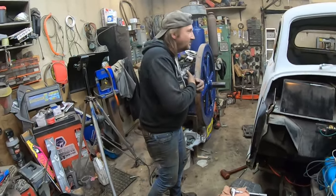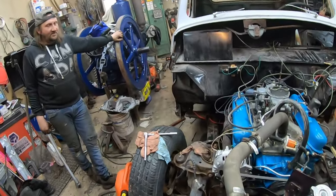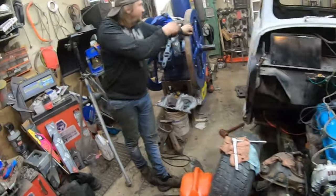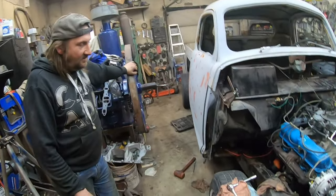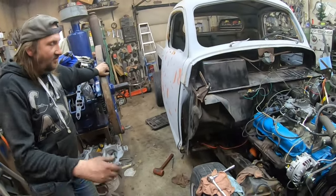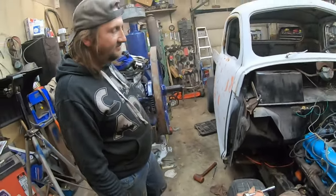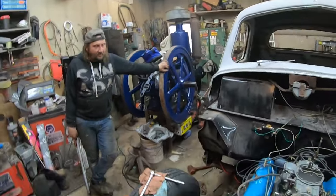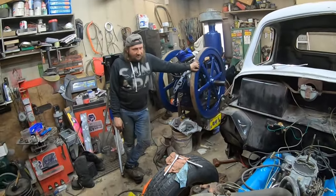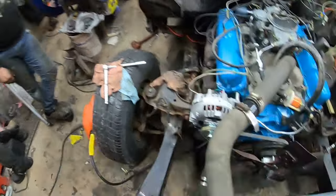It's been sitting for almost 2 years. Yeah. You know what happened? Still got to change that stupid brake line piece. Oh yeah, the proportioning valve. Yeah, proportioning. It still works, but it doesn't work properly. I got a new one. Yeah. Don't buy the cheap ones off Amazon. Yeah. No, that's the second bad one. Yeah, Corey had the same problem. So we bought a Wilwood, and that has to go in.